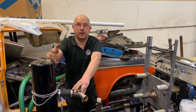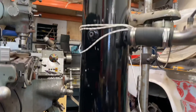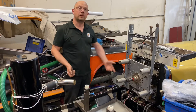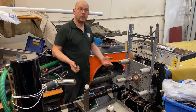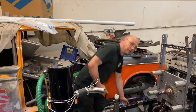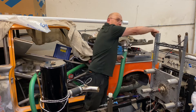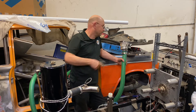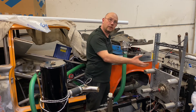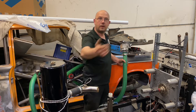Over here we have a tower. The tower contains coolant, so essentially the engine is, for all intents and purposes, operating exactly as if it's in a car. The dyno is fed with a water supply — it has around a thousand-litre water tank, bringing fresh water in down big hoses to clip onto the rear of it. The same coolant used by the absorber to measure the power is also used in a heat exchanger here to maintain the engine temperature.